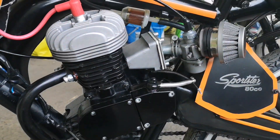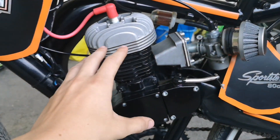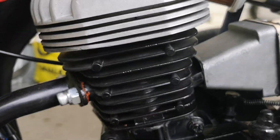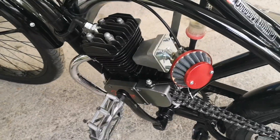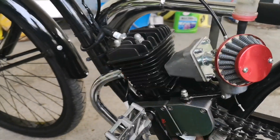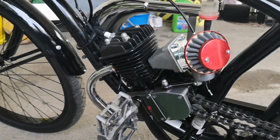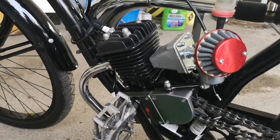This plays a bigger effect once you start upgrading the engine. For example, this engine has a 49 millimeter big bore kit with a G2 reed and a pipe, so it needs a long time to warm up — not only does the piston have to expand, but the reeds have to open up and the carburetor has to get flowing. The more power adders you add, the longer you'll have to warm it up, especially with an iron bore. Also, most builders will tell you not to modify your motor before break-in — stock engines make around 2.5 to 3 horsepower, but adding a reed valve and pipe can push RPM from 6,000 up to 7,000 or 8,000. With the piston already expanding, the last thing you want is to make it rev higher than it should. Only modify your engine once it's past break-in, and after that you'll be golden.